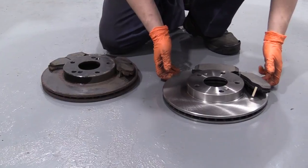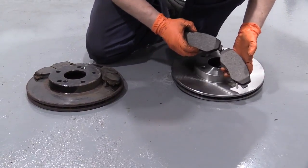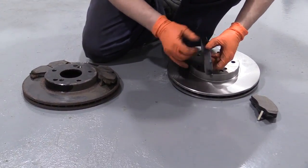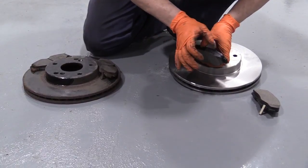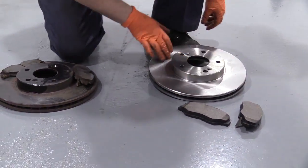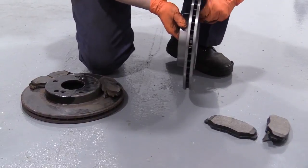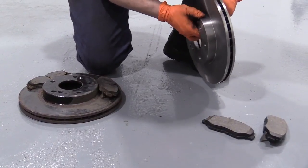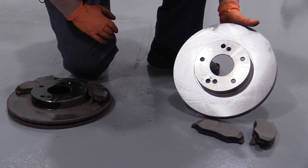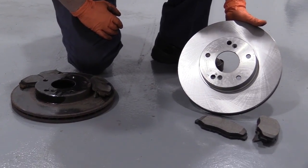Here we have our new rotors for our 06 Honda Element from 1A Auto. We've got the new pads — they've got a nice down-cut angle on the edges to stop the squealing and brake dust buildup, and it also helps cool down the pad. The slotted holes are for the manufacturer so you can put the anti-rattle clips in. It also comes with the indicator and already has the shims mounted on the back. The rotor is a nice cross-cut rotor on front and back, with quality cooling fins matching the factory mount requirements and two seated screw holes for the hub. If you need this part or any other part for your car, click on the link below and head on over to 1AAuto.com.